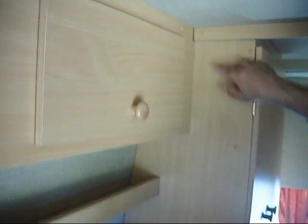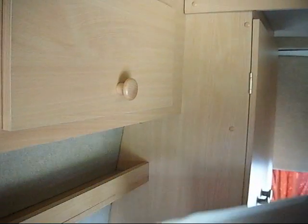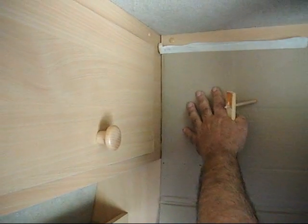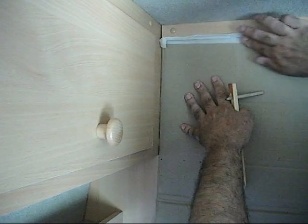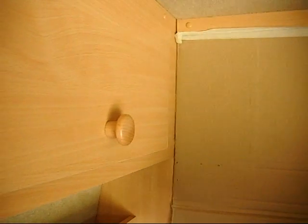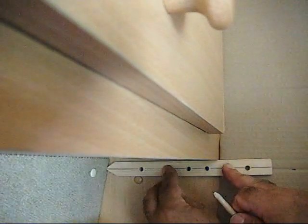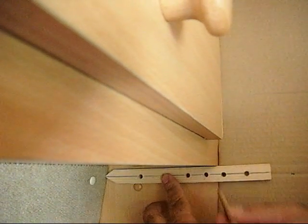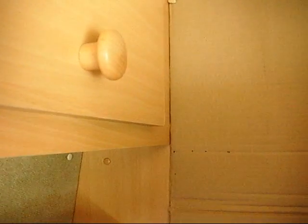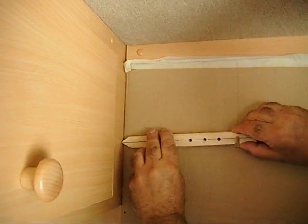Okay, what we're going to do is to cut out this shape down here, round here and on there. But obviously you'll be doing the metalwork of the van, but the procedure is exactly the same. I'm just going to stick that piece of cardboard there. Now with the scribe that you've made up, if we put it inside so it's touching and it's out to there, now we need to leave ourselves enough room. It's no good putting the pencil there, so we'll have the pencil in the end, and then all we need to do is to scribe down the piece of cardboard like so,